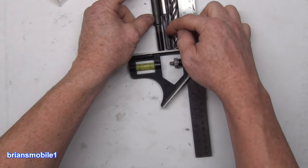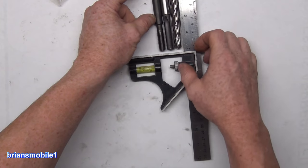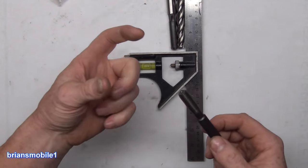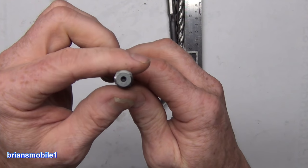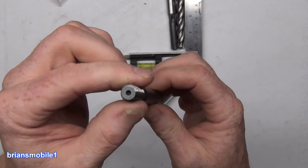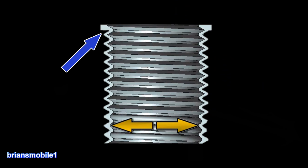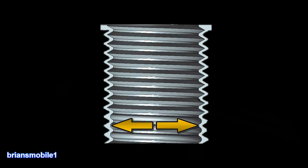So when you drill it down in, this will thread it all the way down there, and your driver will go all the way to the end there. The driver's pretty interesting. You'd think that you could just use a bolt or put your head bolt in the little insert and send it in with that. But this is a special design. You can see that it's kind of square. You can see the nodes on each corner. What they're for is they actually push out. If you do it, you can feel it go ka-dunk, ka-dunk. Core drill and the shoulder lock in the top. Expanding the bottom locks the bottom in as well.